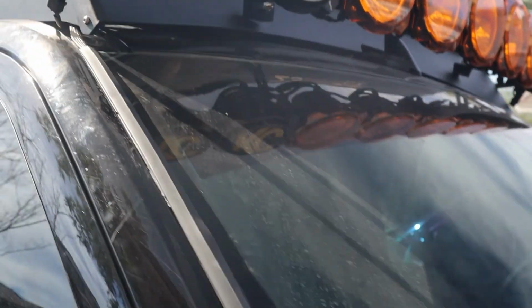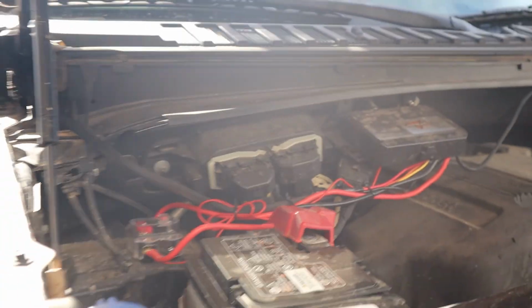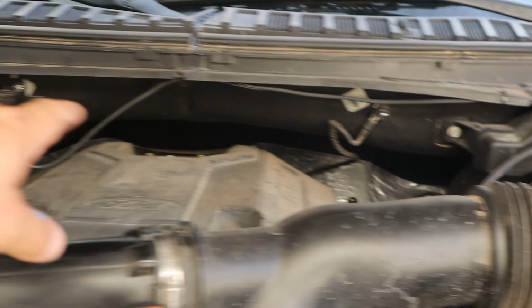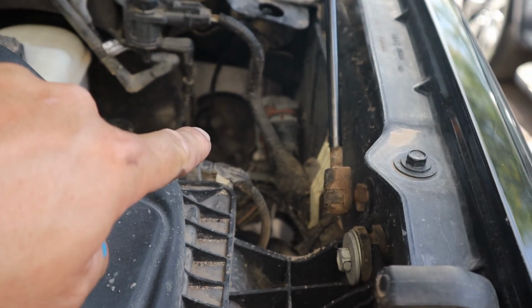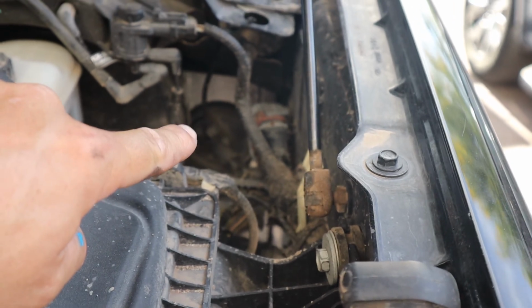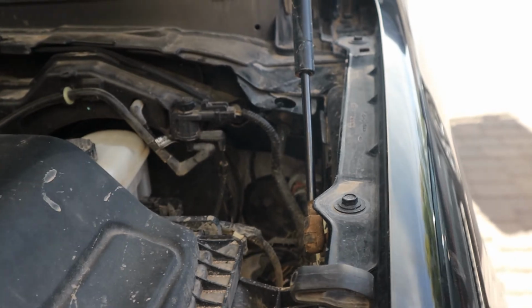And all of those lights are operated individually. So, well, the left and right side are operated individually, and then the front light bar. So I got 3 switches. So yeah, it just runs all the way across over the engine, and then I've got a grommet in there. You can kind of see it. Punctured a hole in that grommet, and that runs to the firewall into the cab.